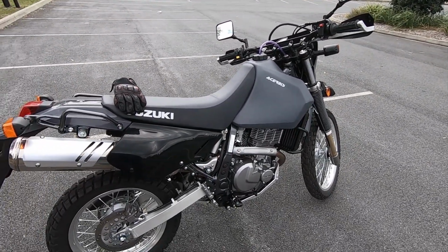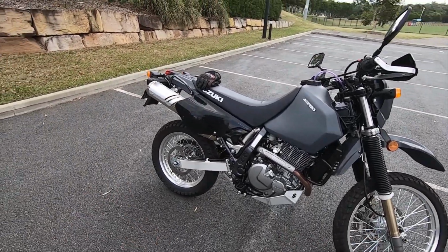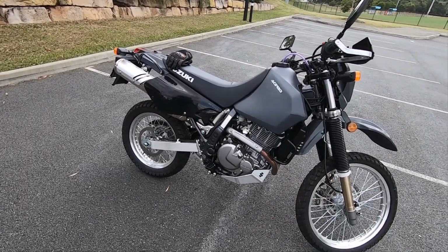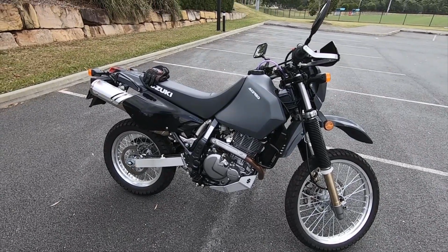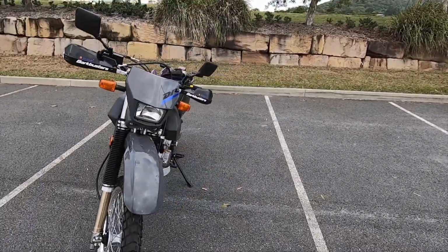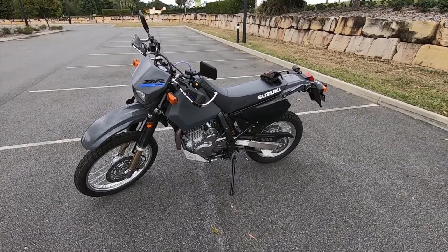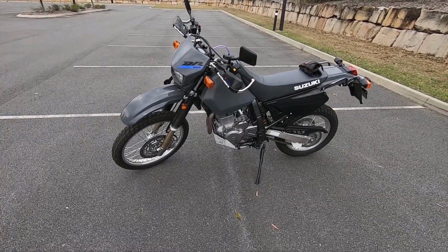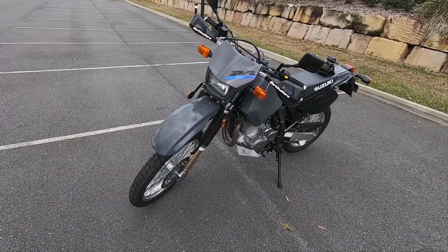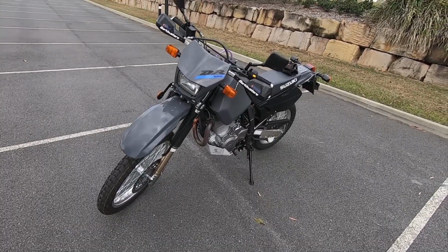And when it's all kitted up, then maybe think about new exhaust, get it sounding a bit more beefy, and with that obviously need to rejet the carb and possibly alter the airbox, but that is a fair way off right now. My primary objective right now is to get it kitted out bit by bit, so I can go adventuring again. So I'll use the running in period to slowly add the bits and pieces. There's no rush because I'm not going anywhere until the bike's properly run in. So we're talking, you know, 1700 kilometers down the road.